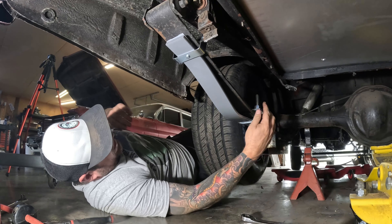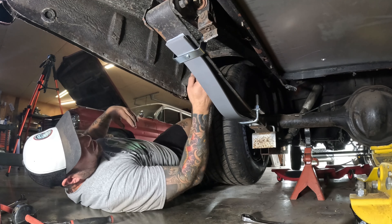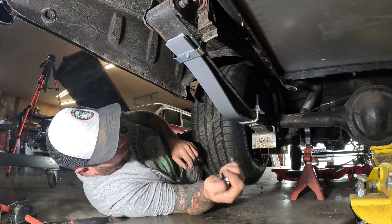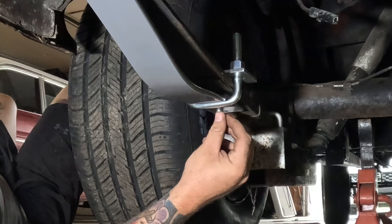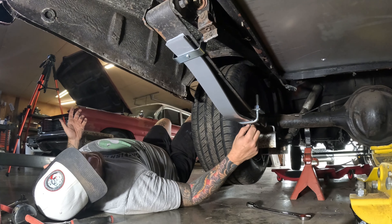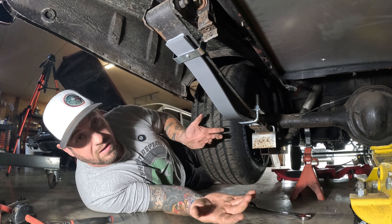I think that's all we're going to do. It says to tighten these down to 75 to 78 foot-pounds, but it's kind of a bear to get a torque wrench in here. I did try — you can only get one click at a time. So we're just tightening down real hard with the wrench and we're going to be at least close to that number. One thing I'll note: I really don't see what this rivet is doing. It's captive and it's not going anywhere, but I also don't see that it's actively doing anything. Anyway, that's all there is to it. We'll do the other side and then drop it down to see if we gained any height.